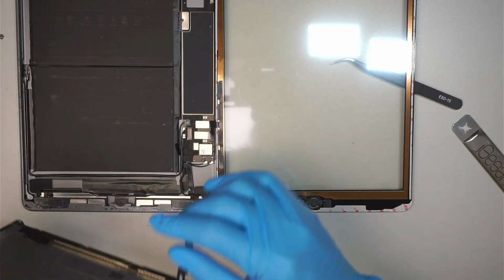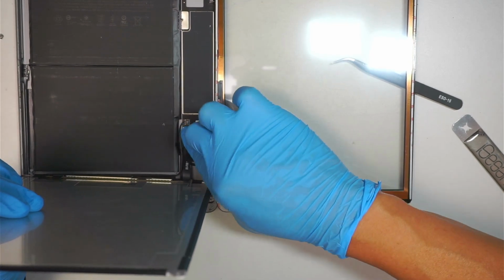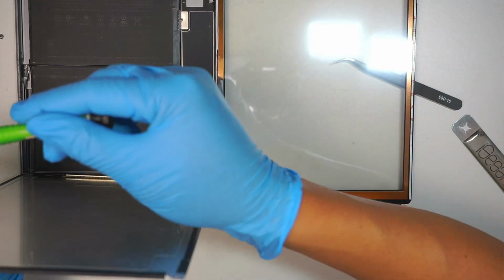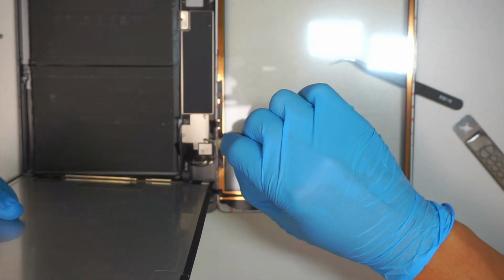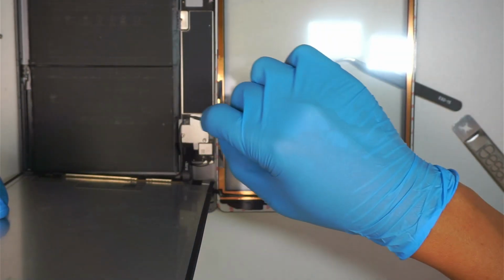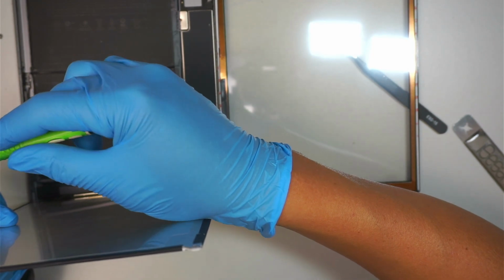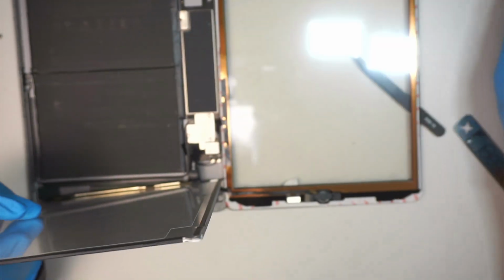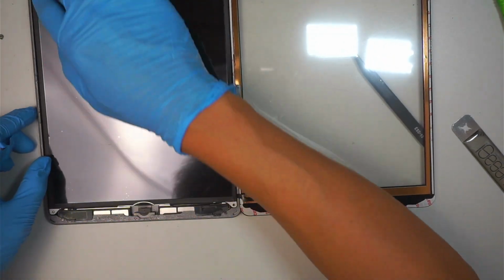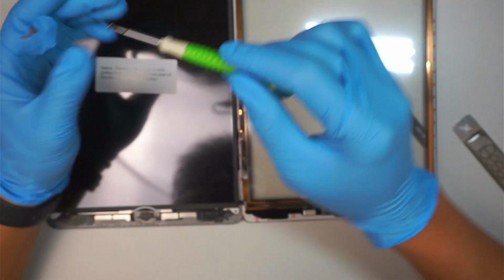Okay, here comes the LCD. All right, here comes the bracket. I think by now the home button should be good. It's already hardened. Okay, and then the LCD screen goes on top of it, making sure it's all the way in. Have the four screws go back on.